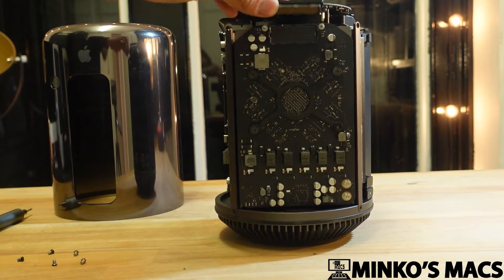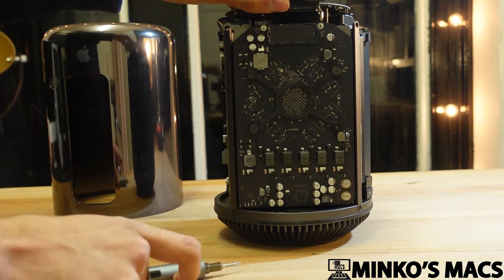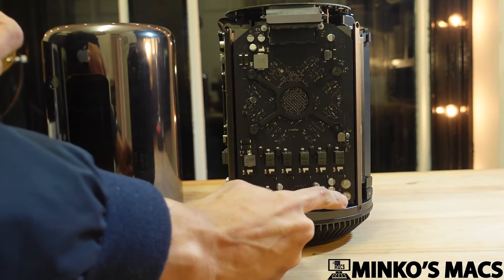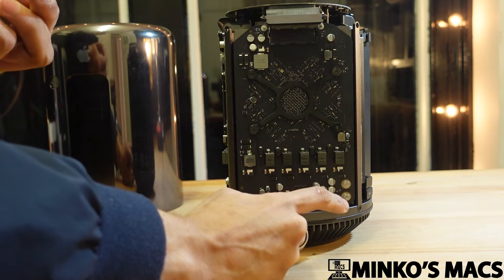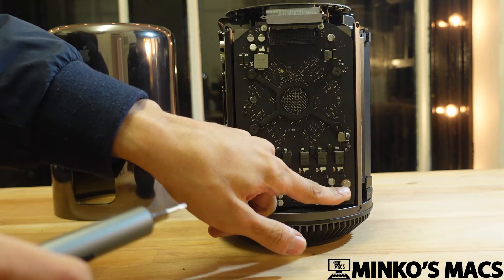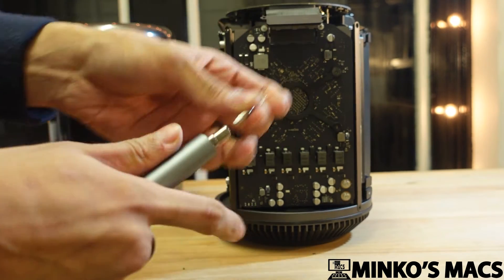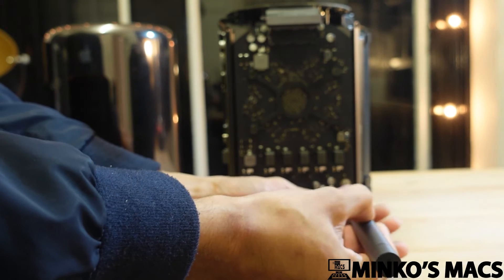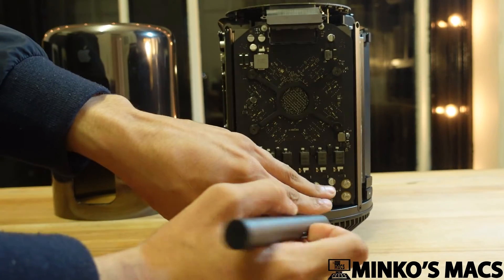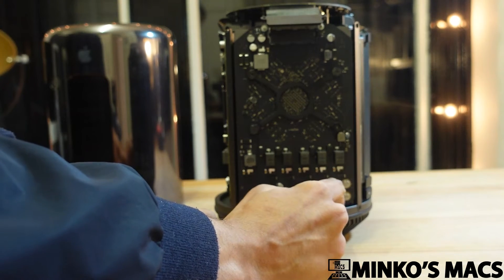The interconnect is very fragile. Once you've done that, you want to remove these two power supply screws. Bear in mind, these power supply screws are not your standard torx — they are the security bits, specifically a T8H, as it needs the tiny push-pin inside the driver to allow the torx bit to go inside. Do not mix up these screws; they are for the power supply and are made from a specific type of metal.